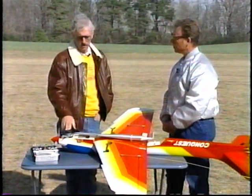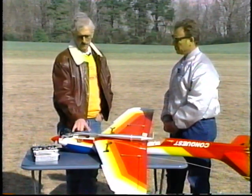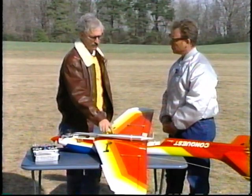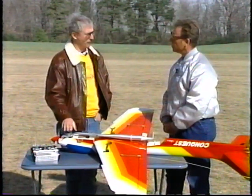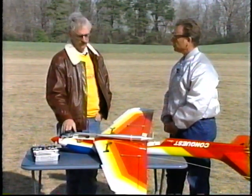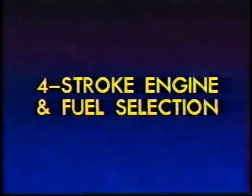As for the YS long stroke, which we're using here, and the Hattori 650 pipe, which is a very popular pipe in the pattern circles, we like to use a 7-inch header, or it's about 14 inches from the glow plug to this screw. And if you're not using a Hattori pipe, use about 16 inches from the glow plug to the high point, or where the bend stops right here. This is a good starting point on the setup. Bear in mind, we're using a 12-11 or a 12-12 prop and about 20% nitro fuel. This setup works very nicely.